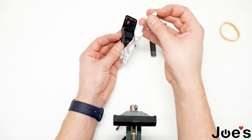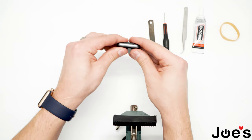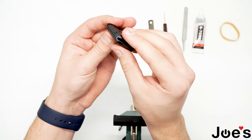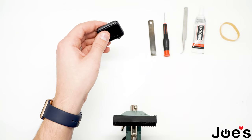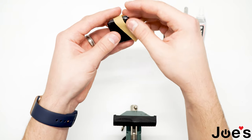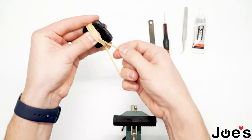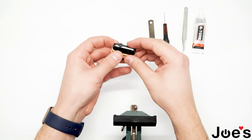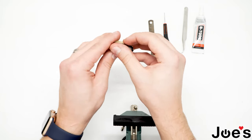Go ahead and close it and apply the screen onto the unit. Make sure to check that there's a nice flat gap on each end of the watch. What I like to do is get a rubber band — a pretty nice rubber band — which will hold the unit in place. Go opposite of the buttons so it doesn't mess anything up, and make two or three rounds to hold the screen together. Let it dry for about two to three hours — it takes a good amount of time to dry so it's fully water-resistant.